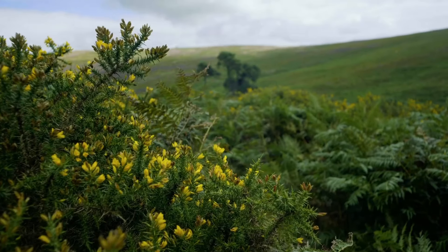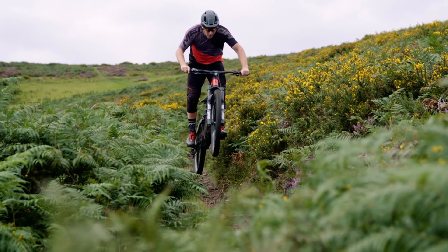The mullet setup of this bike really came across in its playful and agile feel. If you're a fan of the mullet setup, then this is certainly a bike worth considering, but even if you're not, there's very little drawback. We actually went up at the same time with an Orbea 2022 Wild FS, which was running 29s front and rear but was also running the Bosch motor. One thing we did notice: the Bosch-powered bike is certainly more punchy across the cadence levels than the EP8 motor is.